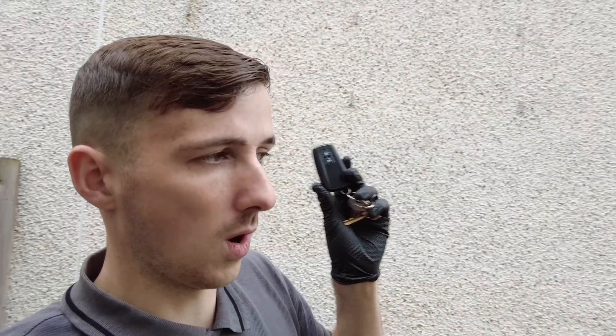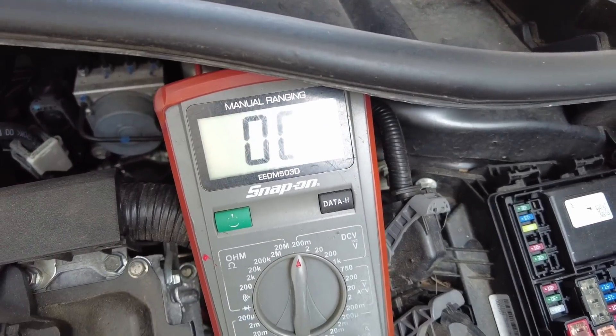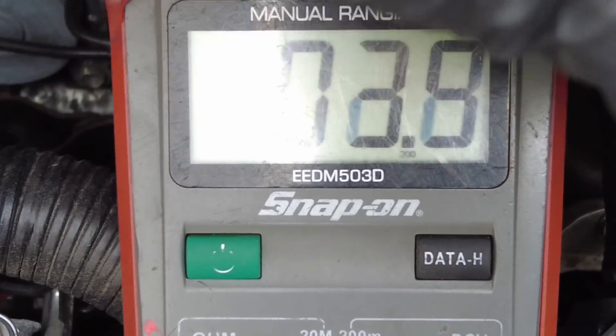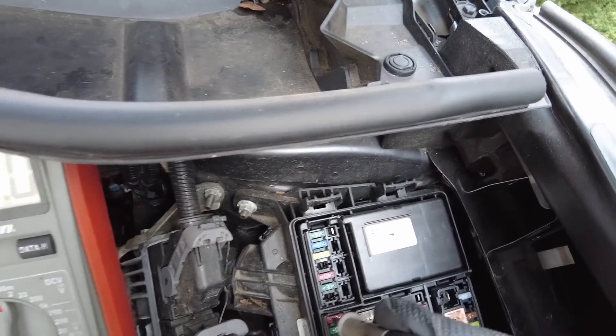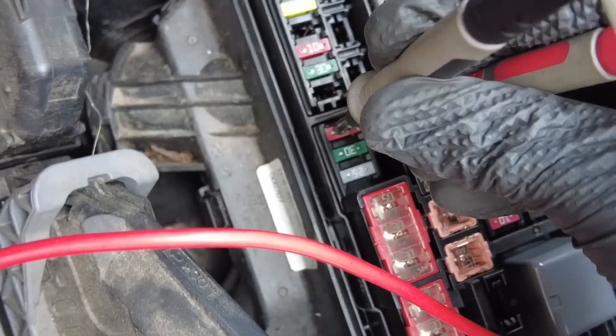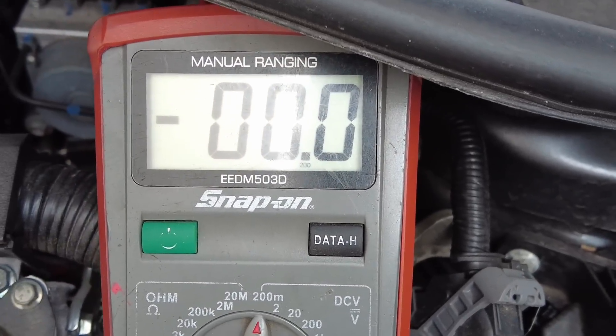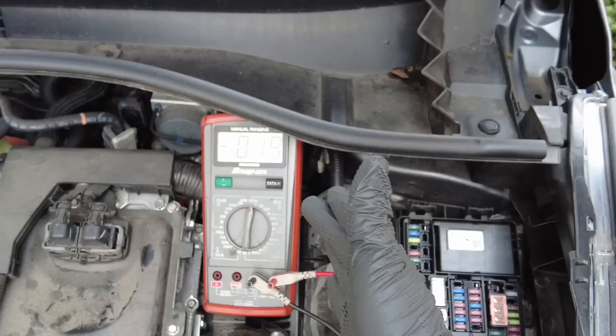What I'm going to do is reconnect the battery back up, open the doors, let the vehicle go to sleep, and then do a millivolt drop test across each of the fuses to confirm which one is drawing current when it shouldn't be. You can see we're just set to millivolts on the multimeter. We're going across that 10 amp fuse and you can see we have got a reading of zero, which is ideally what we want to see.